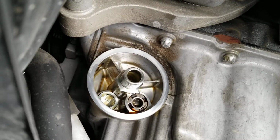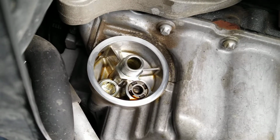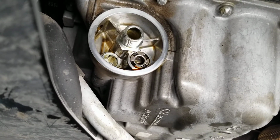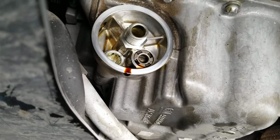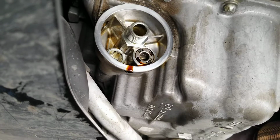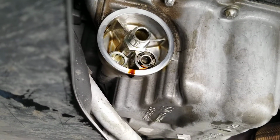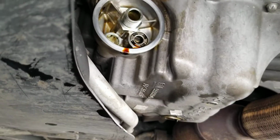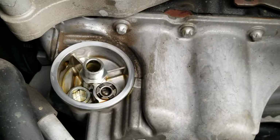for this car. So it's about 3.7 quarts. That's close to 4 quarts. I like to usually leave some gap in there so that I don't overfill, don't put too much oil in, because if you overfill your car with too much oil, it's going to look for a place. The oil will be dripping in there looking for a hole to leak or something. So I'm going to go ahead and put close to 3.5 at least, so I get a gap of 0.2, less than a quart. Alright, I'll get back to you guys so we can reset the thing after we put all the new oil in.